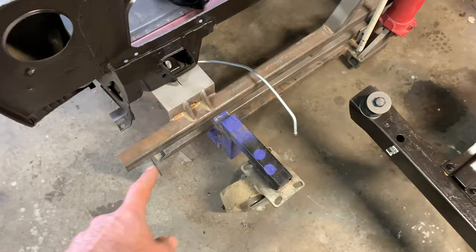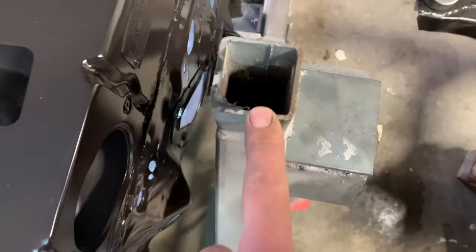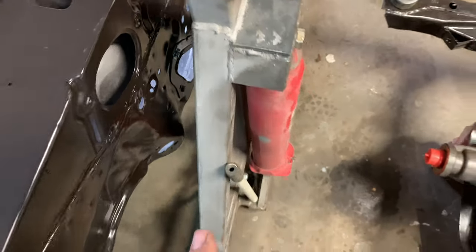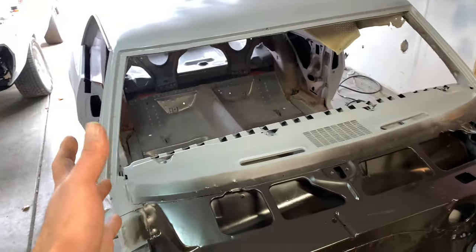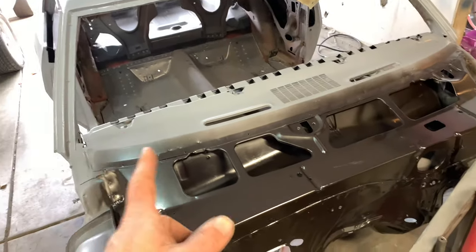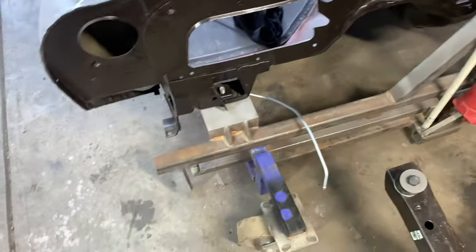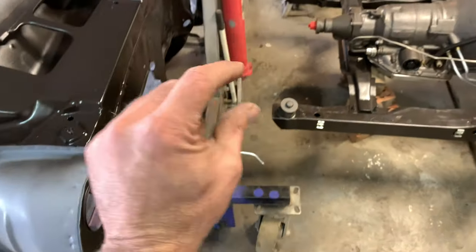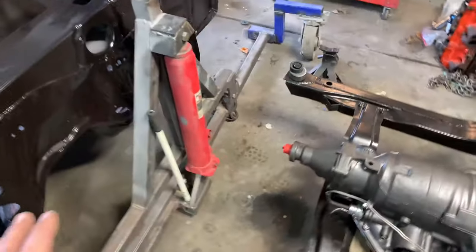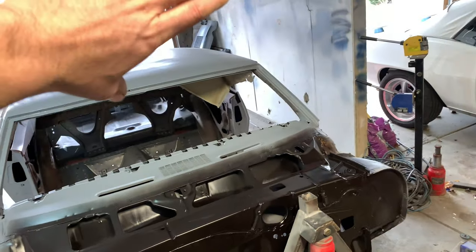Basically just chunks of steel here — two-inch box tubing. The gauge is not super heavy but plenty heavy duty for how I have the cylinder support, probably overkill for the situation. An empty car body, I'm shooting from the hip here, is maybe six or seven hundred pounds — really not as heavy as you'd think. I literally drew this on some graph paper one day at work, came up with the idea, drew it to scale, and figured out where I was going to pivot it. I guessed on the center of gravity.